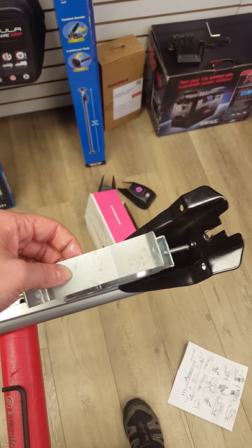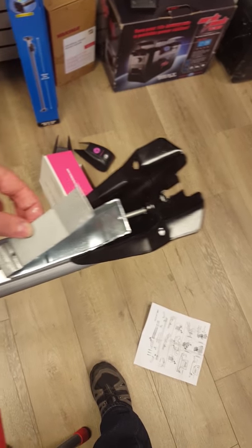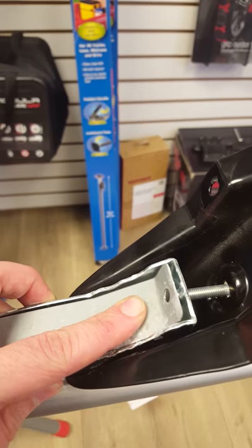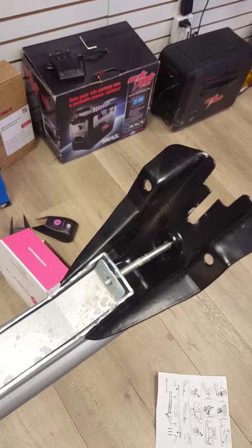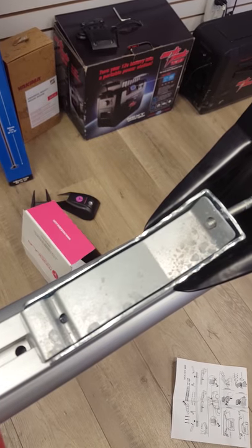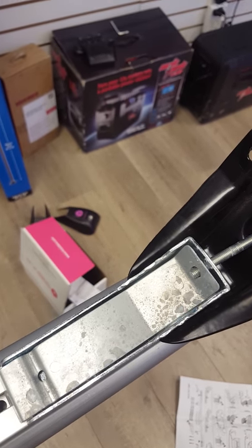Then you're going to put some tamper-proof tin on the top of this. This is the tamper-proof plate that goes in — make sure you don't have access to the screw heads down below. It slides into the track right here, it goes over top of those screws. It will stand too tall initially, but you press it down and then you thread that in until it holds it in place — no further than that — because you want to leave yourself space to attach the roof rack. You can see that the ends of the threads are just protruding through the hole, everything is flush, and those screws underneath the bar are no longer visible, so anybody trying to access those to steal your bars cannot get at them.